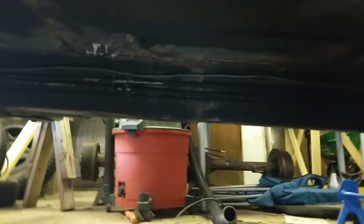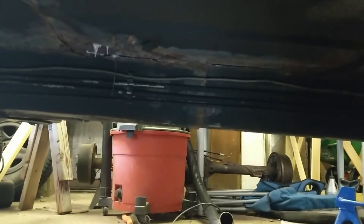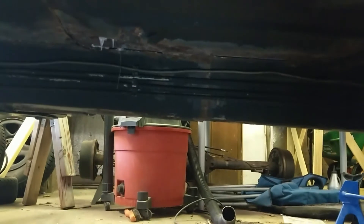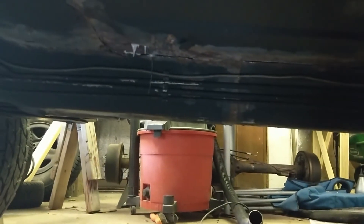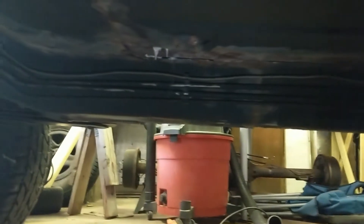I don't know what grade the hardware is, but the tank's holding up so it's good enough. The fuel filter obviously got replaced. Redid the brake lines — you can see the top one there is new copper-nickel line that's soft enough you can bend by hand, so it's not perfectly straight but it works.